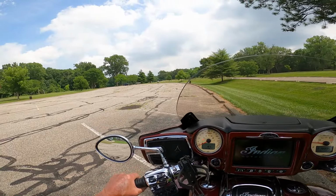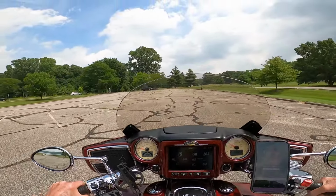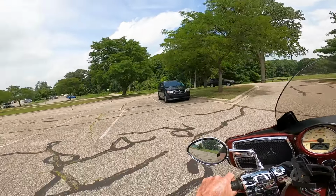Okay. Now there are a couple things that I did to this motorcycle. Not too many as far as the drivetrain goes. I put on Rush slip-on mufflers. I left the same header, and I did not clear out the catalytic converter, so that's left alone. And then I installed the high capacity airflow and had it flashed for those components, and that's basically all I did for the performance of the motorcycle.